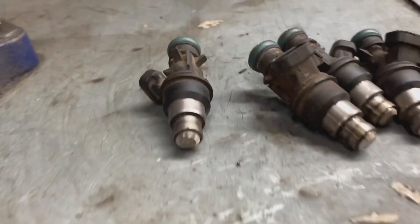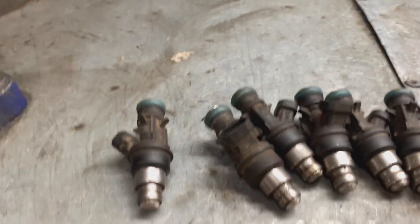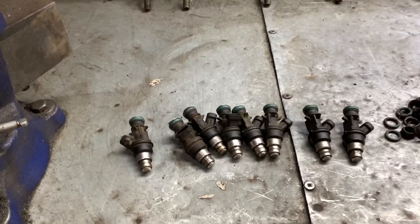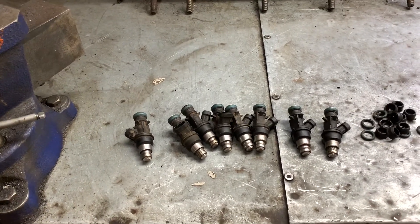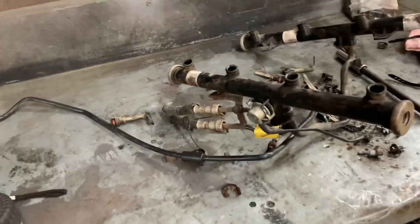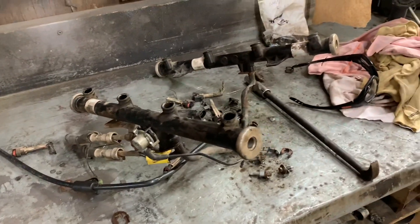Here we have our new decapped injectors — all worked successfully, no damage to the pintles or the seating surfaces. When I did the rat rod I ended up with eight 80-pound injectors out of a full box — I had something like 30 injectors and they ranged from like 50 to apparently 130 pounds per hour according to that bag, which I'm not quite sure of yet. I'll be making a test bench out of one side of these rails, four measuring cups, a timer, a fuel pump with a fuel pressure regulator — it's going to look just as ridiculous as pretty much everything else I do.